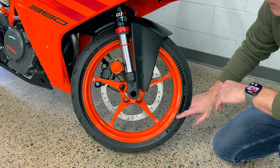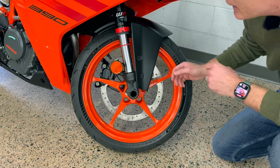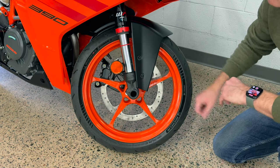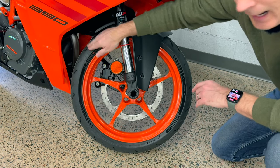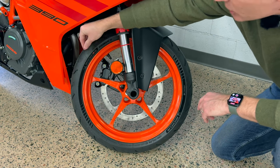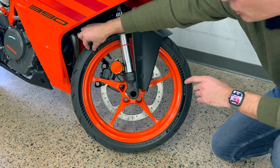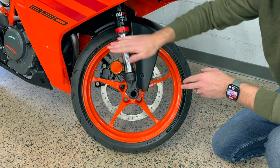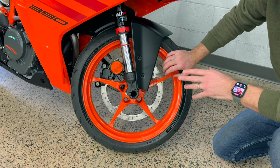The tires are something you don't see on other entry-level bikes — and again, this isn't really an entry-level bike. This is a Michelin Power 6 tire. The rubber compound is a little bit more grippy and it has good wear characteristics, but it also has more of a slick section on the edge of the tire. Instead of running tread out to the edges, you've got a stronger slick section there, so when you get right over on the edge you've got a full-on slick, which is pretty handy if you're going to take this bike to its limits.